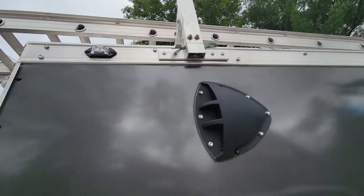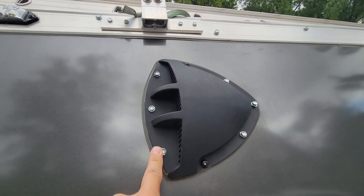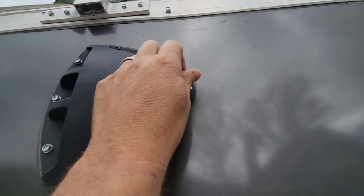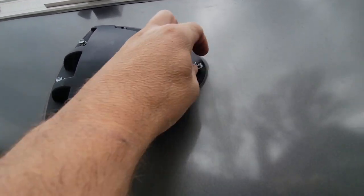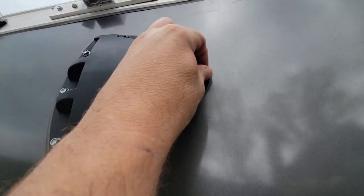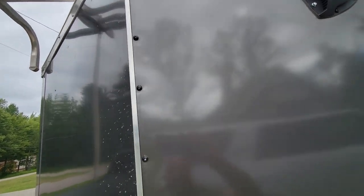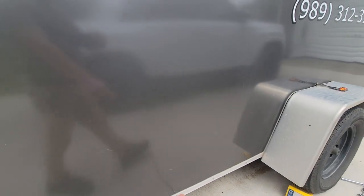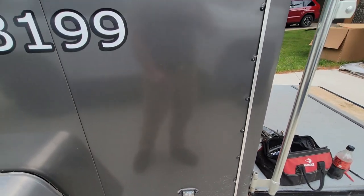That light's still good. Look at all the ones I had to replace in this — the black ones were original, the silver ones are ones I had to replace. And look here — it wore itself through the sheet metal to the point where it's just not even biting into the metal anymore. It's just chewed through. Got to fix that. We check all these bolts all the way down — you check all of this stuff all the way around. You'll find you have to replace trim pieces or bolts that go through trim pieces. This is just part of the game.